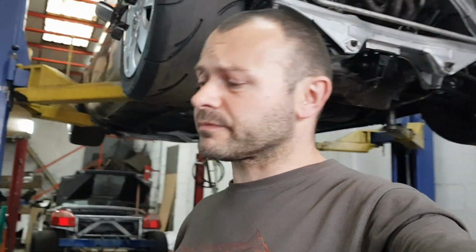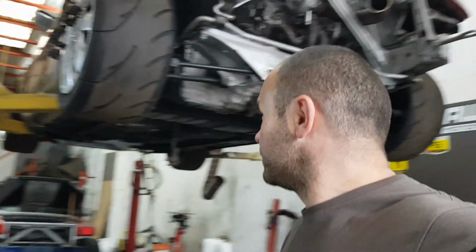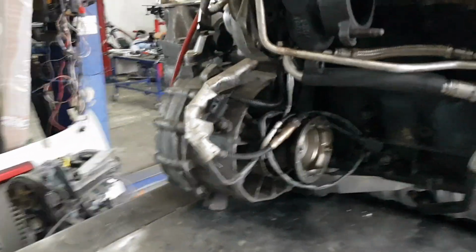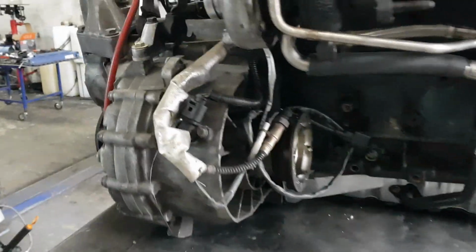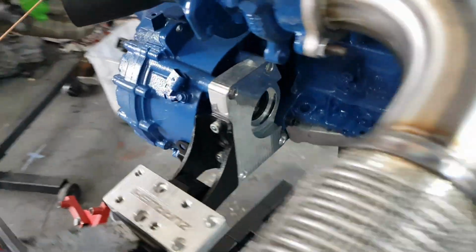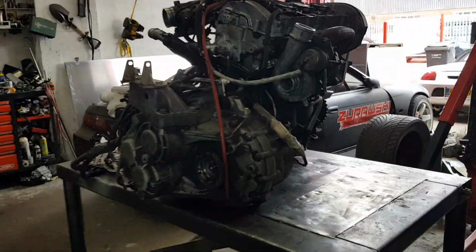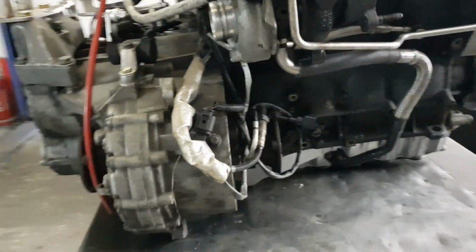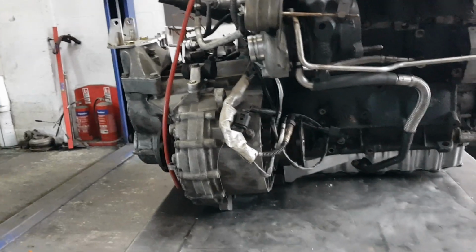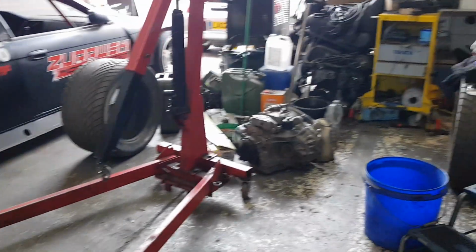Quick update. Now I'm going to put this engine with the quattro gearbox and put it there. Oh, this engine here, excuse me, does not come with this gearbox. This is a front wheel drive gearbox, and because now we're only using all-wheel drive gearboxes to be able to use these fancy mounts on the back. These are the best ones. This will come with that quattro gearbox with a new upgraded rear mount, because only the rear mount changes. I'm not sure what it is because we have a lot of gearboxes.